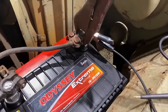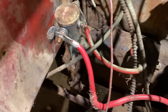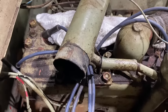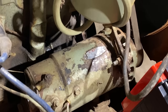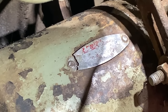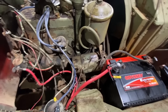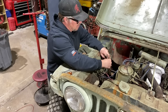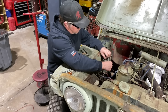Let's get some wiring on this thing. You can see how I clamped the negative battery terminal tight with some vice grips and everything else was spinning. Up there was that rag that was kind of blowing in the wind — lucky I had that up there. This is the generator. Most of the time these old generators are 6 volts, though some are 12 volts. It has a tag right there and I tried to read the numbers but couldn't make out what they were, so I will probably end up replacing that and going to all 12 volts. I am removing the coil from the ignition system to try and figure out what voltage it is.